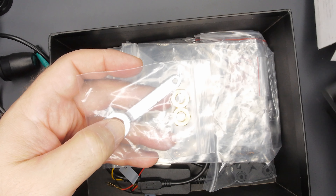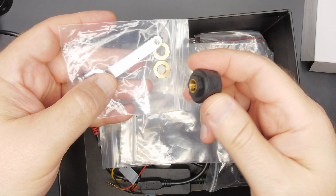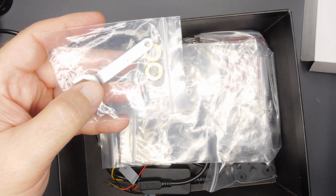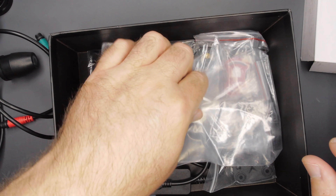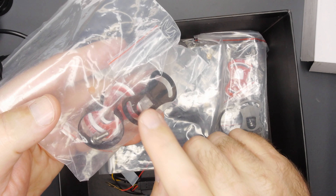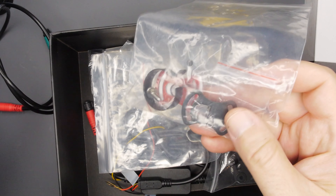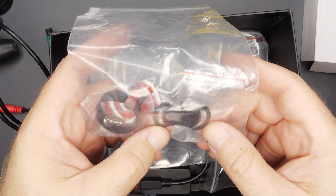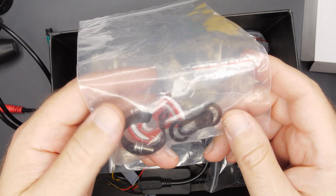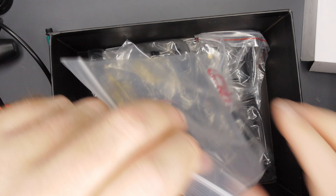These are the same locking nuts for the tire pressure monitoring as seen in other units, plus some caps. There are tools for gripping and undoing the sensors, which I'll be using to measure battery voltage — so far all of them have come with low or depleted batteries, so we'll double check that. In here we've got — and I hate to see this — the same brackets as another brand, I think it was CarperRide, where I absolutely hated the mounts. They're even smaller, single-sided bent-up tabs — absolutely terrible and you're going to want to do something else with your mounts.